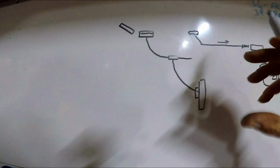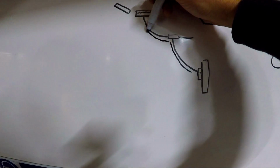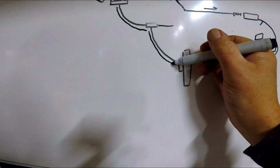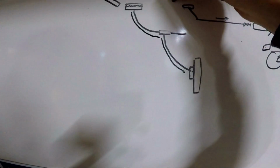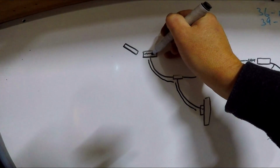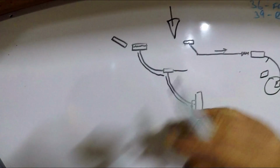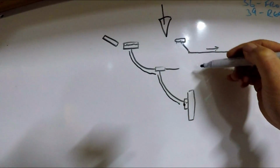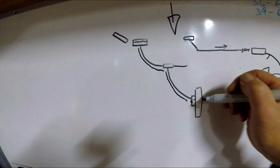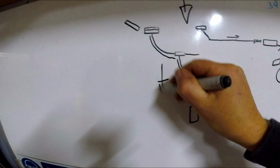But basically, and some people quote that they prefer to purge the fluid up this way and purge the air up through the top of the master cylinder. In doing so, I don't agree with this method, because gravity, obviously what goes up, everything has to come down. As long as you keep this master cylinder full of fluid and don't let that empty anywhere up to this point here, you are not going to get any air in the system. Therefore, as this bleed line comes through from here and purges through to the ABS valve, as long as you've got fluid in there, you will not get any air through. So the secret of bleeding brakes, okay, and what you'll do is you'll have this then to the bleeder and then to the bottle. Keeping in mind gravity.